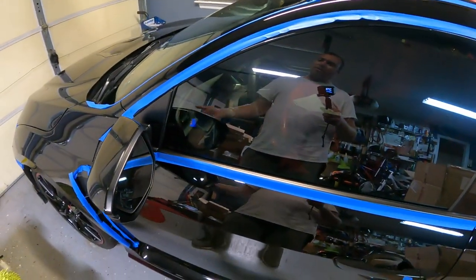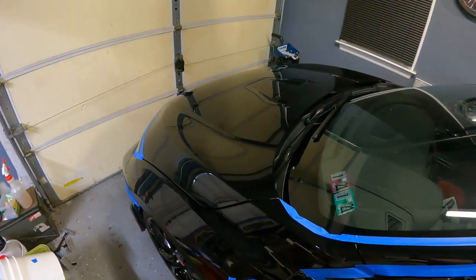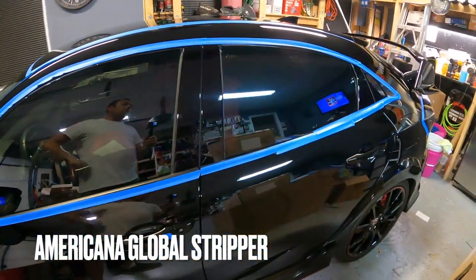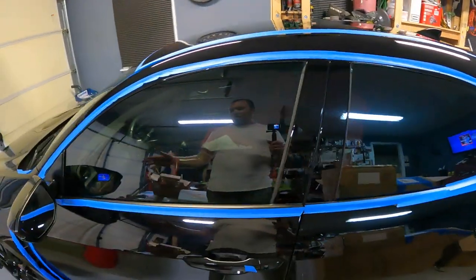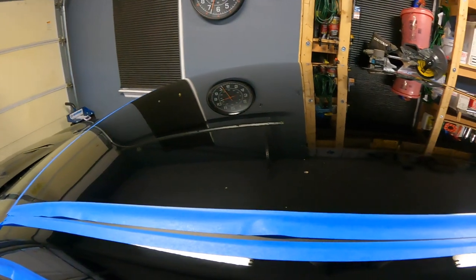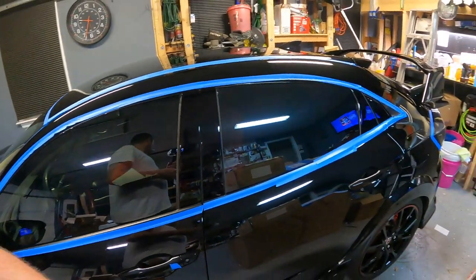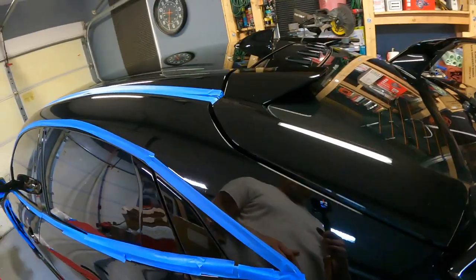I'm not going to go any further tonight because it's 9:30 and I've been working crazy hours at my regular job. The next step from here would be to go through with a wax and oil remover — Americana Global Stripper is the product of choice — and use that to get off all the fingerprints from me touching the car while applying tape. It'll also work to get the bugs off. I'm not going to clean it tonight because I'll just get more bugs by tomorrow. I'll keep the fans on to keep air moving in here so hopefully there will be fewer bugs.